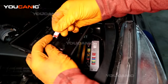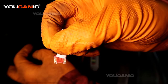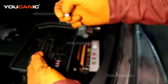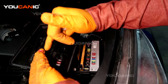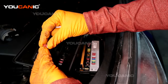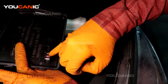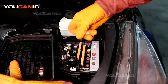Take the fuse puller, pull it out, and what you want to look for is in the middle of this fuse — you see that little hump in the middle. If that is burnt out or black, then you would want to replace it. You can also use a test light and test between the two prongs, or use a multimeter and test here and here to see if you have continuity. If you don't, then you would replace it. This was a 10 amp fuse, and you want to make sure that you replace it with a 10 amp fuse.